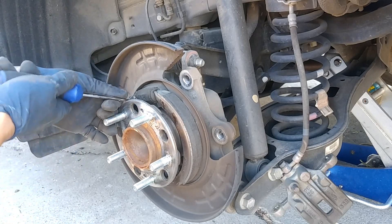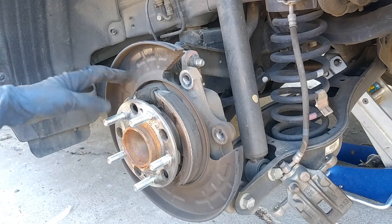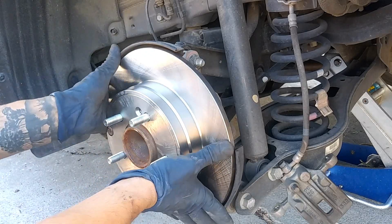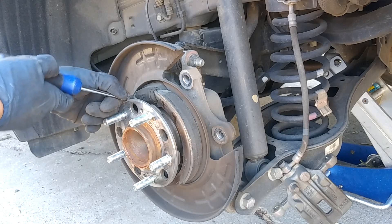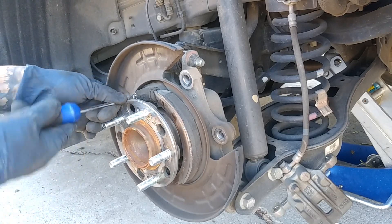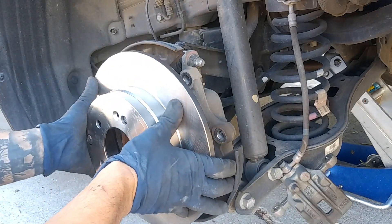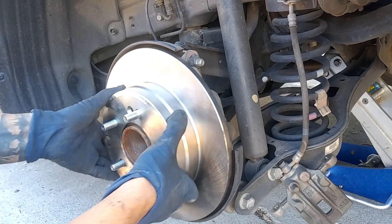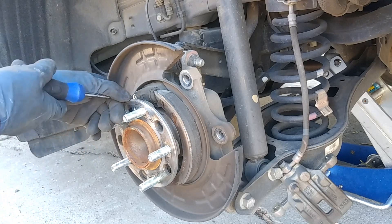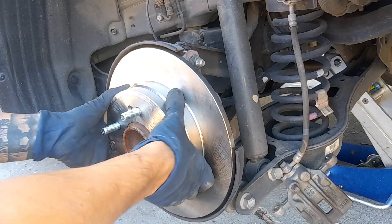You're going to turn this adjuster — flip it around — so now it's starting to build tension. I'll start testing it in and out. It's still loose, so we're going to keep going, probably about half a turn or 180 degrees. When the adjuster goes 180 degrees, we'll put the drum back on. That feels pretty good — it's snug — so we'll go another 90 degrees. That's perfect.